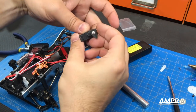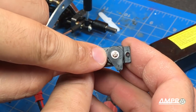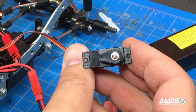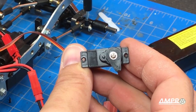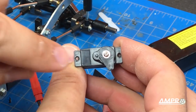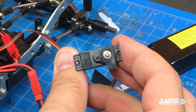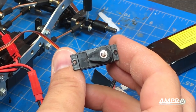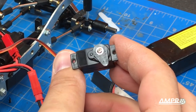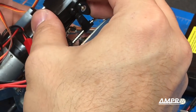In trying to sort the transmission, I discovered that the resting place of the servo horn for low gear should be horizontal. This means you can either adjust the trim, which I could do, but it's just a lot easier to set this thing back slightly further rear so that it doesn't overextend. Then you'll be all set, and you can fine-tune the trim if needed. The glue should be all dry and we can drop this straight back in.